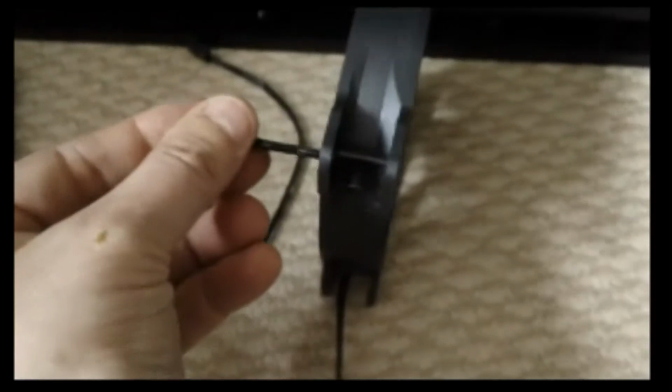That's all very well. However, the screws that come with it are that long. So if I get the original Corsair fan and put the screw through the hole, see it sticking out a little bit. If I then get the other fan and put it through, it sticks out a whole lot more because it's obviously 10mm slimmer. If you just screw that in as it is, those screws will go straight through into the radiator, because the screw holes on the radiator outer case, or outer frame really, are actually directly above the radiator fins, so you can screw right through it, and there's a potential there to put a hole in it.